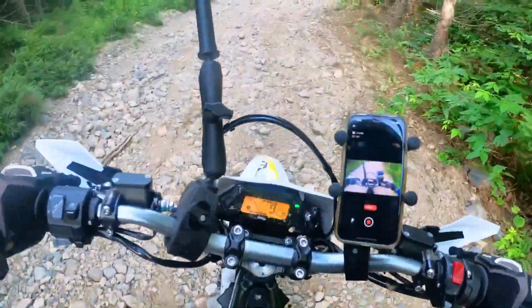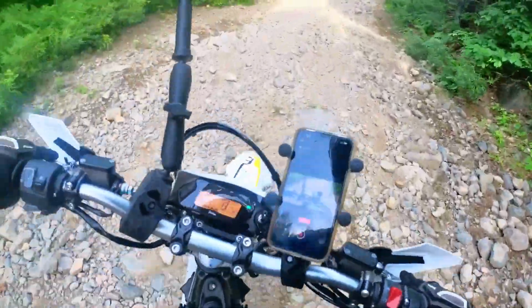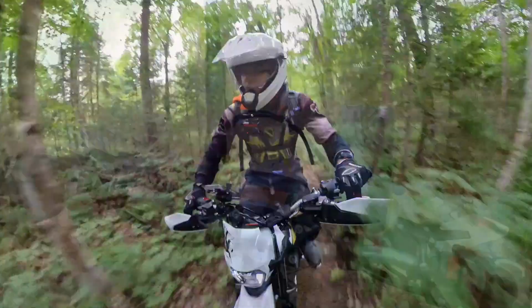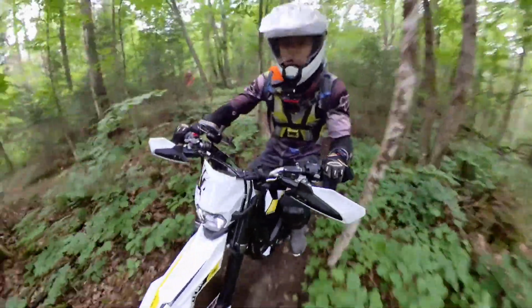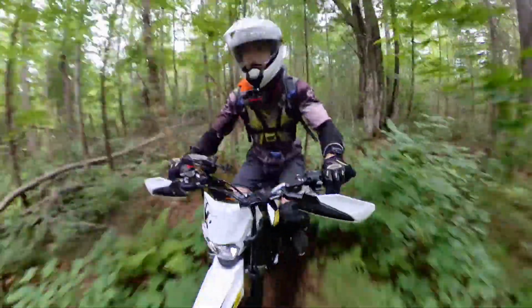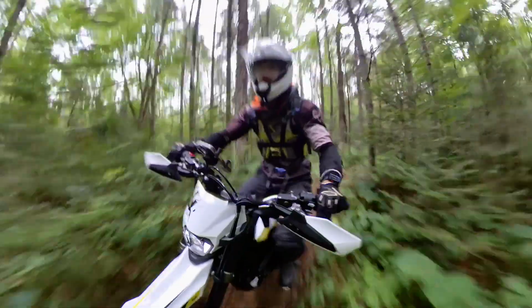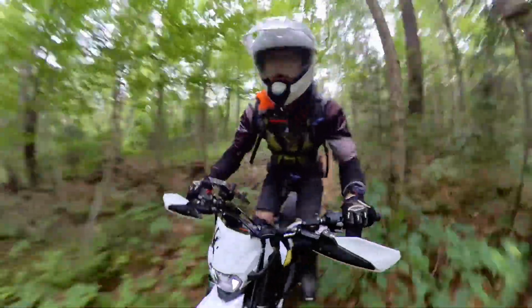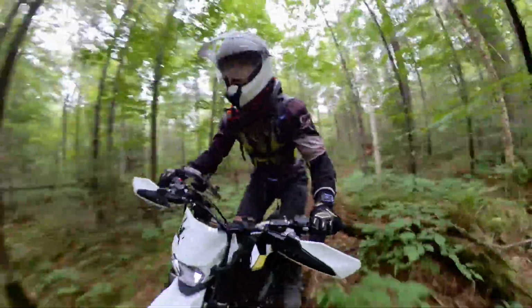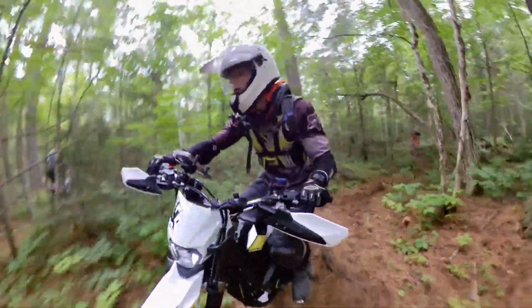Additionally, I like the fact that there are no gears or back foot brake to operate, leaving the rider's feet and full attention on guiding the bike to the best line. Some will lament the loss of the clutch to regulate engine power, but to me the throttle can be finessed well enough so that I won't much miss the clutch. On the other hand, if you like to ride a significant distance to the trail, ride in longer events, fill up with gas in the middle of your ride, or simply like spending time working on your bike, you're probably better off with a 2 or a 4-stroke.